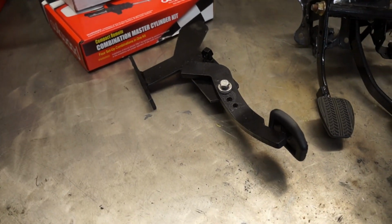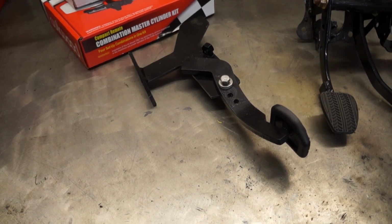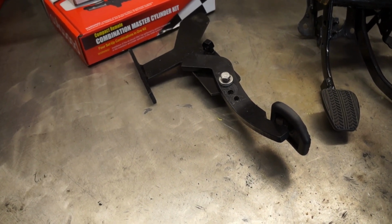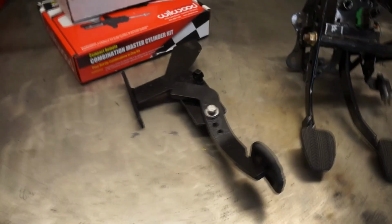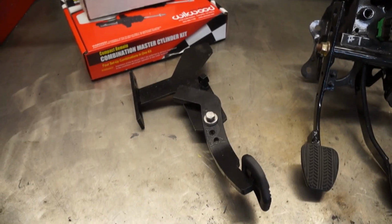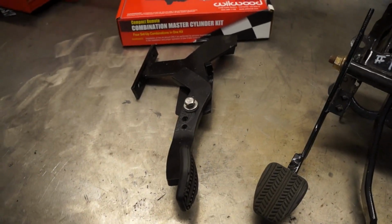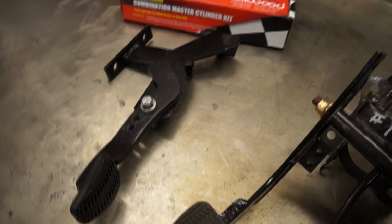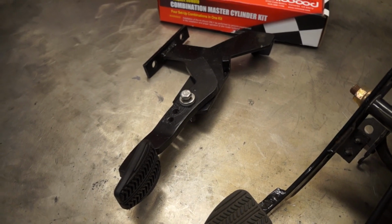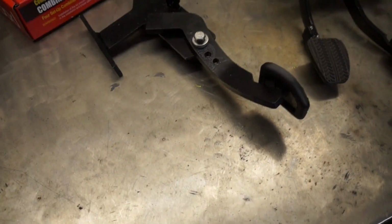Now there's ways to improve the pressure by basically getting the smallest master cylinder that you can have without running out of stroke, which is the case on this kit. This is the minimum master cylinder size required to have a full clutch release with a modern driveline slave cylinder. Now it does the job. It's going to be a great kit, but talking to Chris, there's going to be some adjustment made to the hydraulic kit. Still using the same master and slave, but physically speaking the pedal will change to compensate for the lack of leverage with the pedal itself.